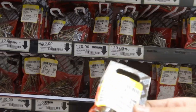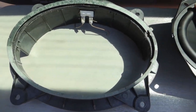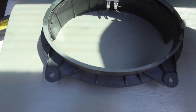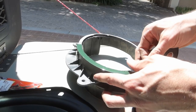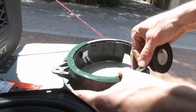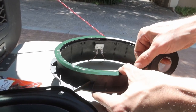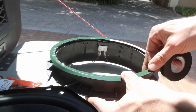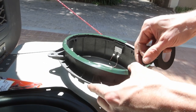My dad apparently does have files at home, so I just grabbed the bare necessities. I've managed to file down the edges and it's now fitting great - just pops in there. I'm going to put some double-sided tape along the edge, push it in, and run the self-tappers through. Just making a nice little seal around the surrounds - keeping in mind it is an open-back speaker, so it doesn't need to be a perfect seal like you'd use for a sub on a sealed box.